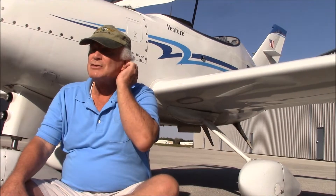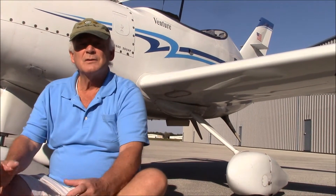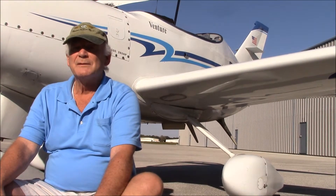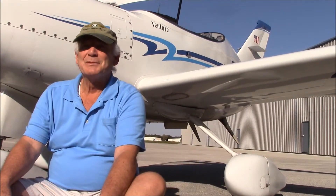The other thing is I had a little trouble figuring out how to land it in the beginning, because the gear was so finely faired in with the fixed gear, and there were no big gaping holes in the bottom of the airplane like you'd have with a normal retractable gear airplane. The airplane floats a lot, so you have to learn to pick your touchdown point earlier. Once I learned how to do it it was no problem, though of course I had no prior experience flying the airplane. I've converted completely to fixed gear. There are about ten kits out there doing that, and roughly four airplanes right now that have the fixed gear — and all of us really like it a lot.